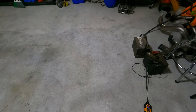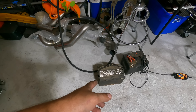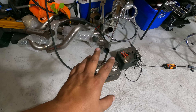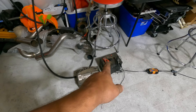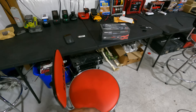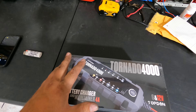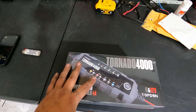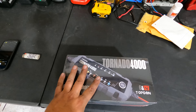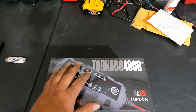I got a couple batteries to try it out on. I've got a six volt battery that goes in my '55 GMC truck — that battery I'm certain is just flat dead. This charger is six and 12 volt: it has 12 volt normal, cold, AGM, 12 volt small like motorcycle, normal and cold AGM, six volt normal, 12 volt lithium, and 12 volt battery repair.